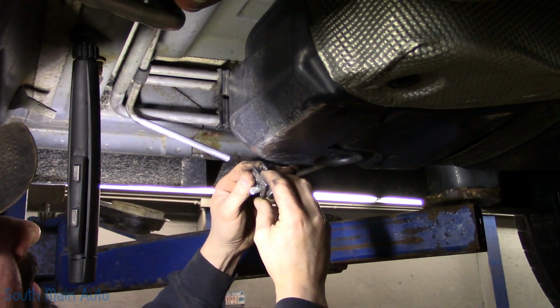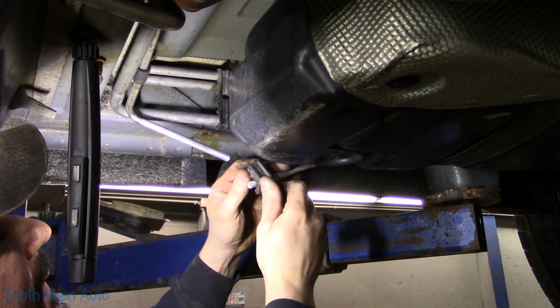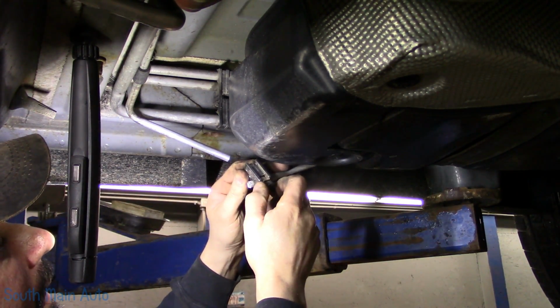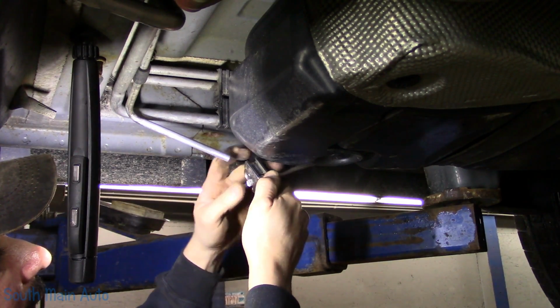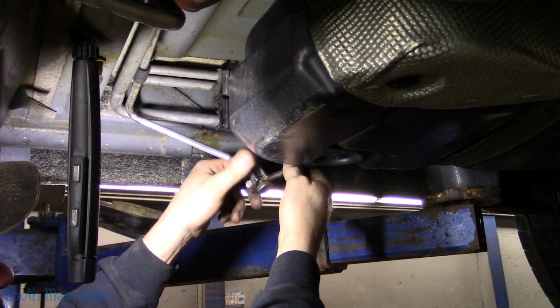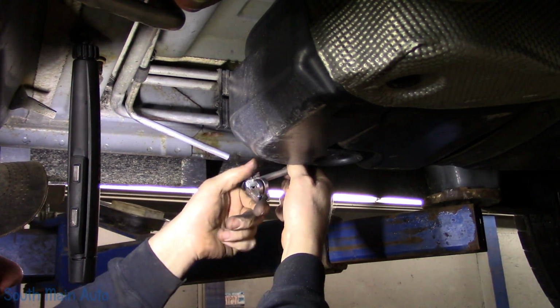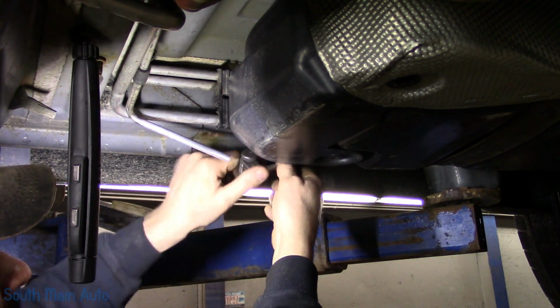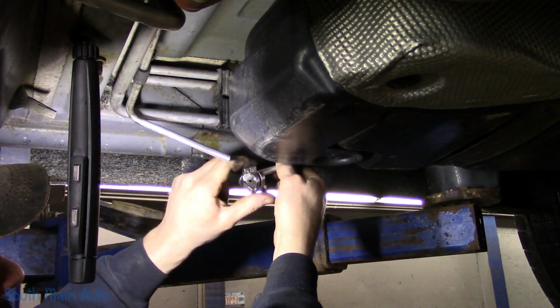Let's take and stick this on there now. We only got so much room to play with here. Of course, this line can be pushed ahead some. But you do have to get all the crust off now. I'm not going to try to just jam this all in one shot. We'll give her a little short turns here. Try to keep from putting a bell on the end of this one.